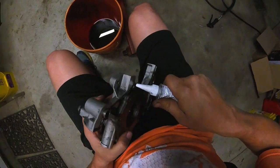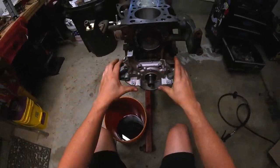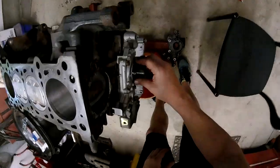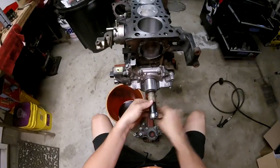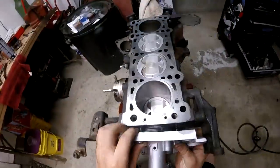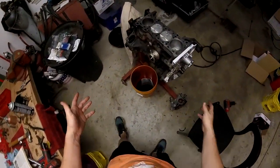Be sure to chase the perimeter of the oil pump with Permatex so you don't have any leaks — there is no gasket here, so Permatex is the only seal. Then we'll reuse the original hardware and torque it to spec. The front main oil seal gets lubricated before we put it on, and then I reach for my super sweet Flying Miata tool and use that to press it on to perfection — the same way we did the head in the previous video. The water pump goes on with a new gasket from Mazda, and again we reused the hardware and torqued to spec. It's starting to look like a motor again.